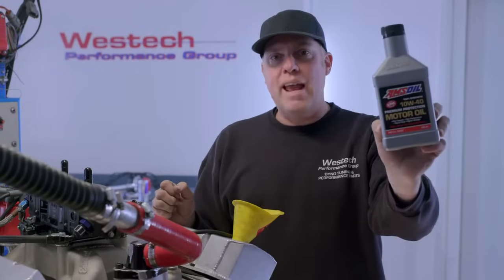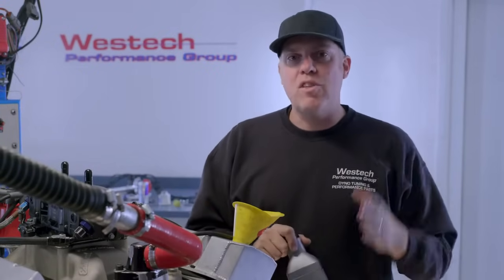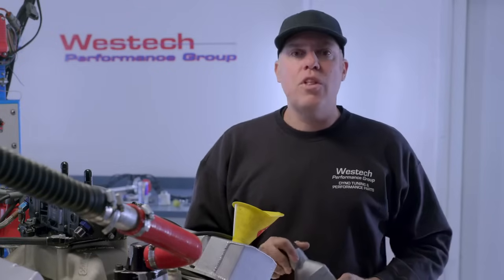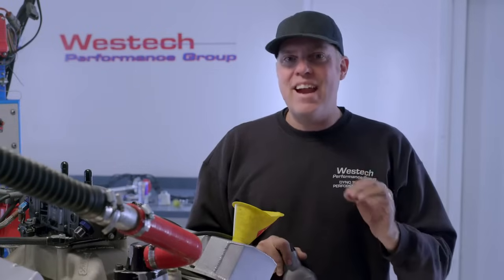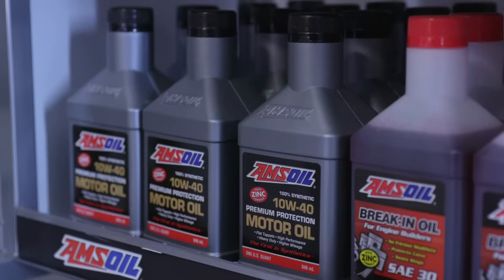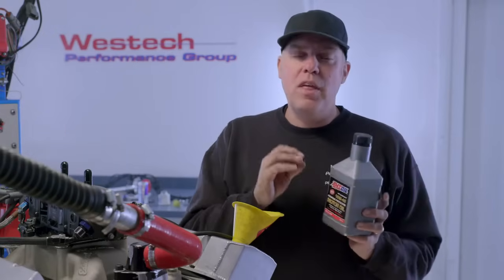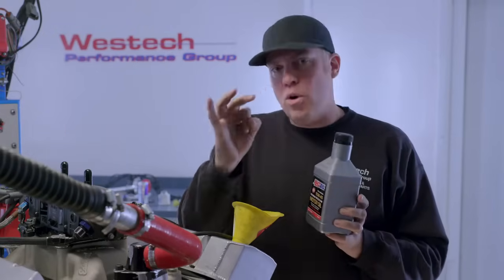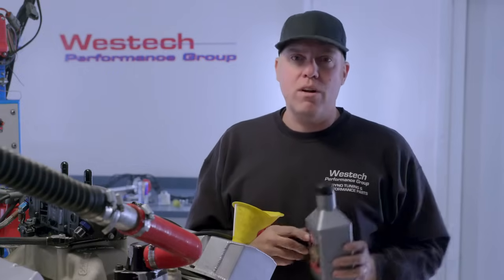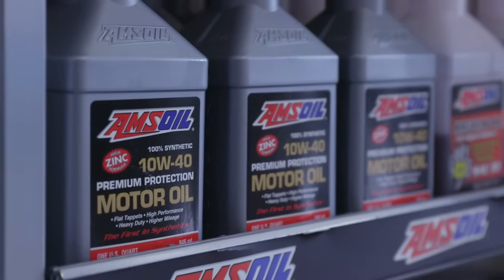It's time for the AMSOIL Super Sauce. We called these guys and told them what we were doing with the solid versus hydraulic cam showdown. Their concern was making sure that the hydraulic lifter was not affected in any way by oil viscosity or pressure, which can change with temperature. So they advised the premium protection 10W-40, which is a thin enough oil that it's not going to be affected by the orifice size in the side of the lifter, and they say it'll be really stable regardless of temperature — so we should get a more scientific test.